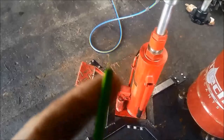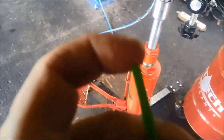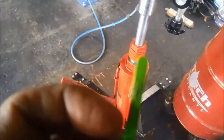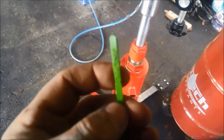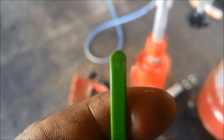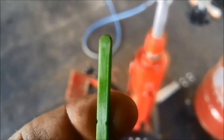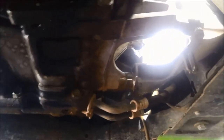A trick you can do to get these in better — when they're new, they're actually square at the bottom. So I just sort of round it off a bit and it'll just go into that housing a lot easier, especially if you have to twist it and manoeuvre it. So it's just rounded off a little bit at the end instead of square, and that way it won't hit up against anything in the housing — it'll just go in a lot easier. 35 degrees.